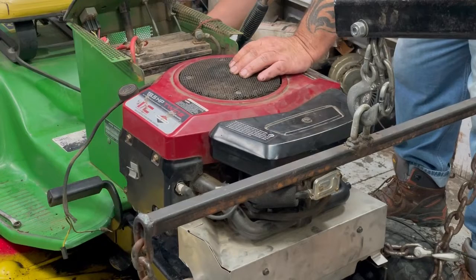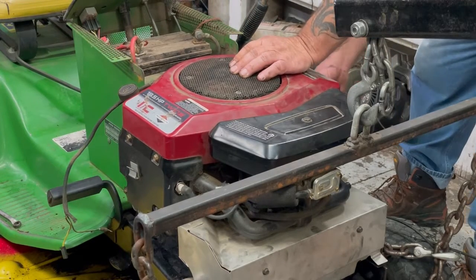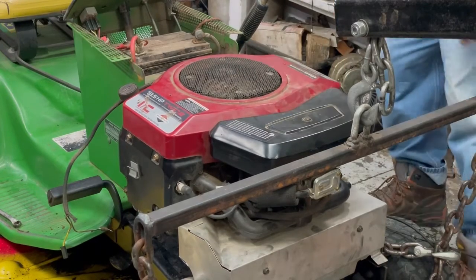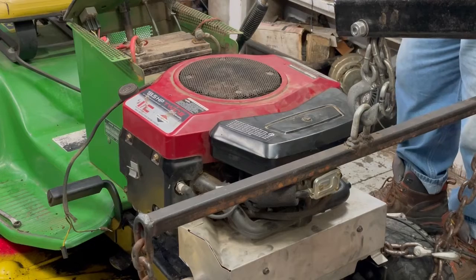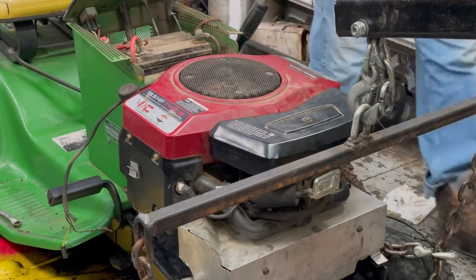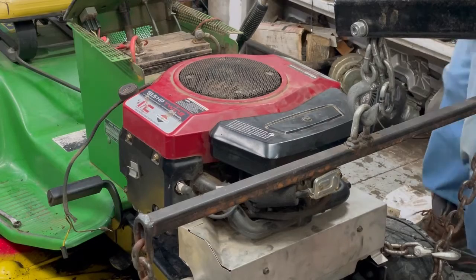There we go. I can go ahead and jack it up. Now I'm going to hook up this fuel line and put the fuel on and bolt up the wire to the starter back here real quick. And I can jack it up and hook everything up underneath up front. I'll grab me a 7/16 inch nut for that starter. It'll be a 1/4 inch bolt. A 7/16 wrench will fit it.